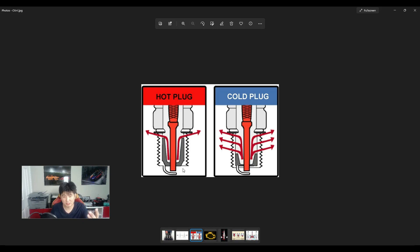That's the basics of how heat travels in a spark plug — it's not crazy rocket science, but it is physics. In order to make optimal, reliable power without risking engine damage from the wrong spark plug, you need to pay attention to this and keep your cylinder temperature at the optimal rating. There's no way for you as an end user to know exactly what's happening in there, but tuners will determine exactly what kind of plugs you'll need for your car based on the tune and modifications you're doing.